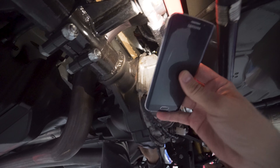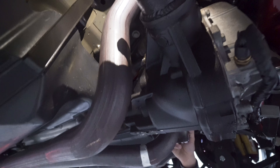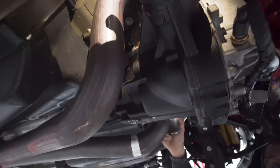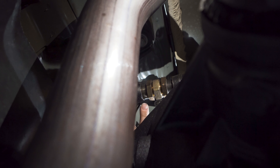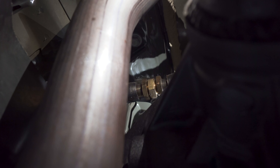This is the watts link right here, but the problem is the upper control arm. There's the adjustment link, the center adjuster, the center piece — this is a fixed nut and then the two jam nuts lock these pieces down, and these have backed off. Long tube headers and upgraded bushings — these things are loud. Once you get past the point of being able to use polyurethane bushings you can go with the heim joint, but that makes a lot of noise driving around town. So we're going to replace this upper control arm with a solid piece.